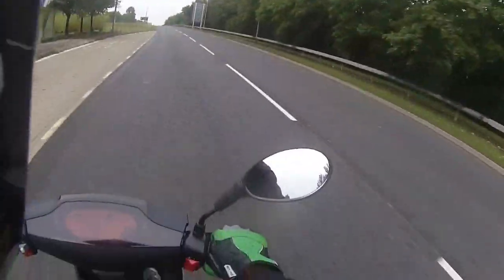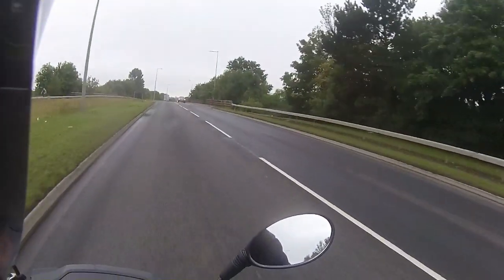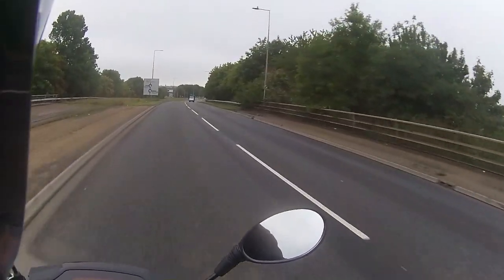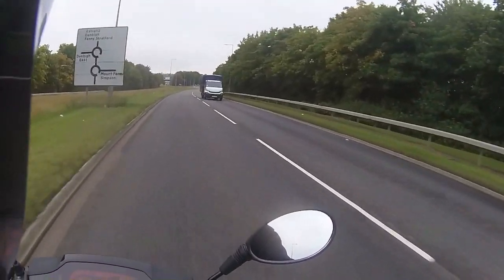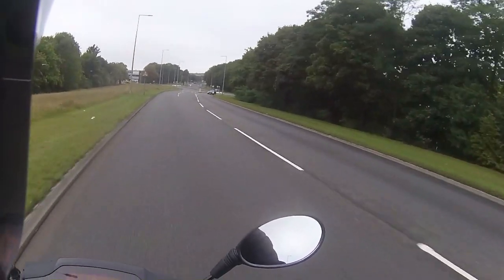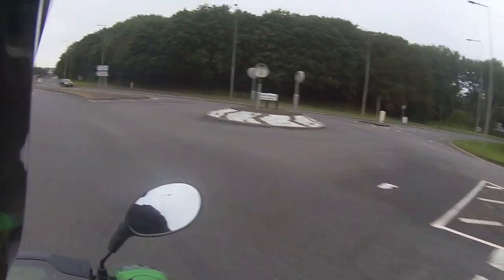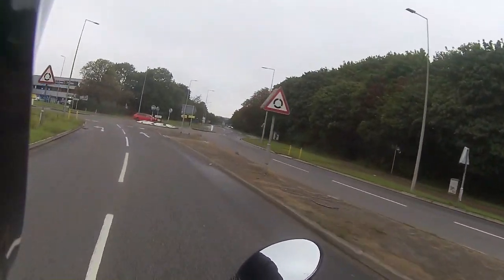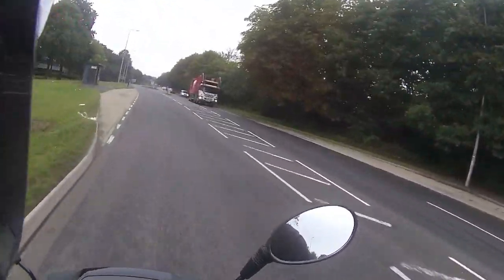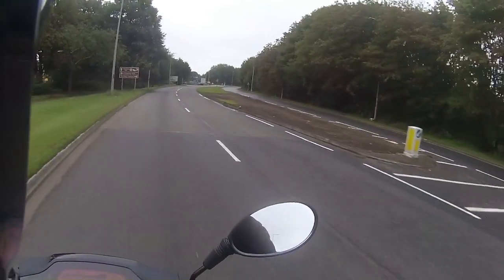Putting the final bit of mileage on this bike — currently at 9.1 miles in. So far no issues with the bike whatsoever, and there normally aren't with any of the 50cc's that Lexmoto do. They can be absolute pigs to start when we first get them in — it can take a while to get that first bit of fuel through because the lines are so small. But once they fire up they keep going. Another word to the wise: do not run your tank dry, you do actually need to get the fuel through the system.